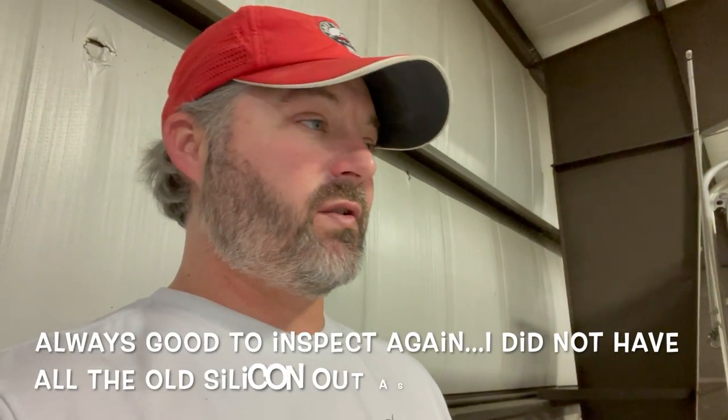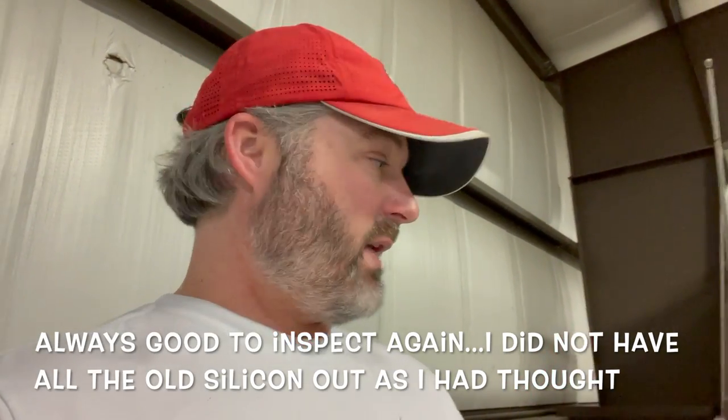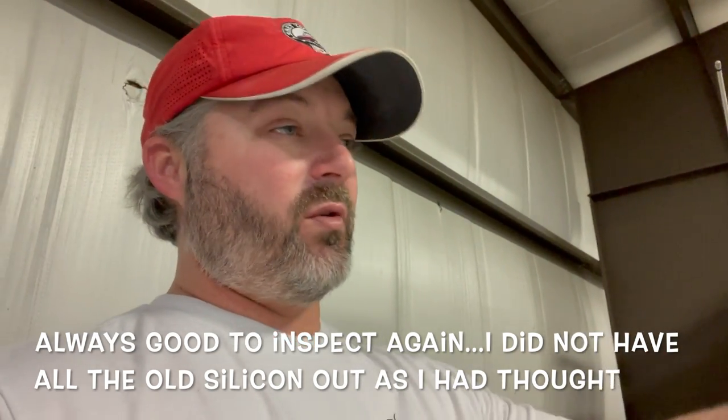So this side window now is ready to be cleaned up. So I'll get the vacuum out and then do one final check around all of the windows. I've inspected all of them with a light, just to be sure that I have the silicone out of the channels. After I vacuum this window, I'm gonna go around and vacuum all the windows one more time and then inspect all the channels again. And at that point, it'll be time to start laying down some new glazing.